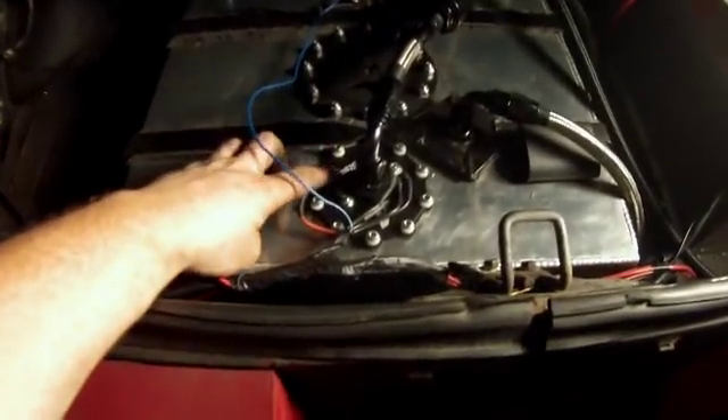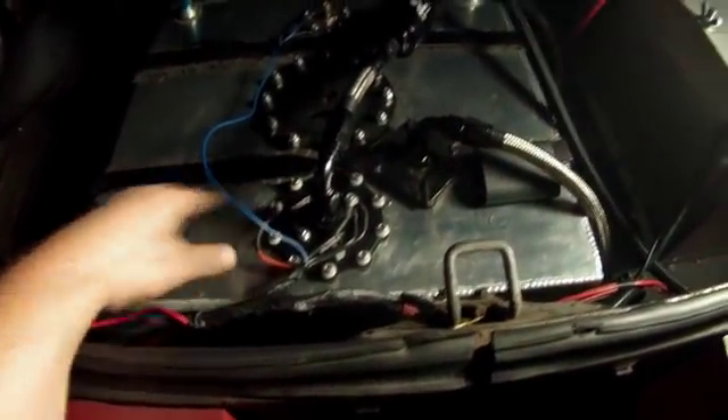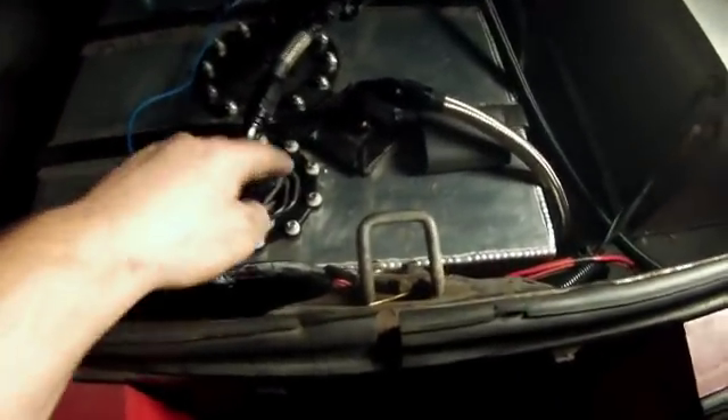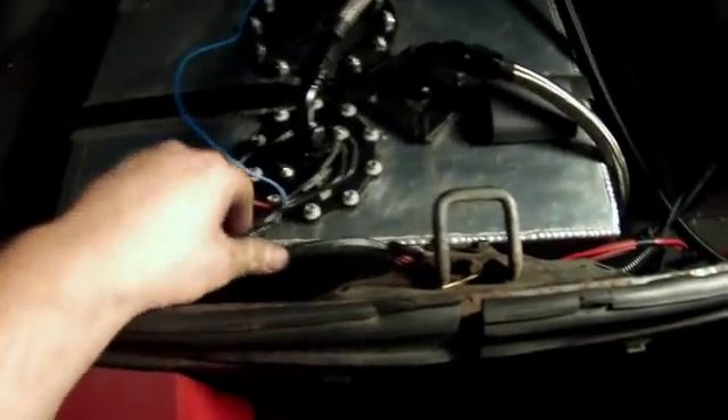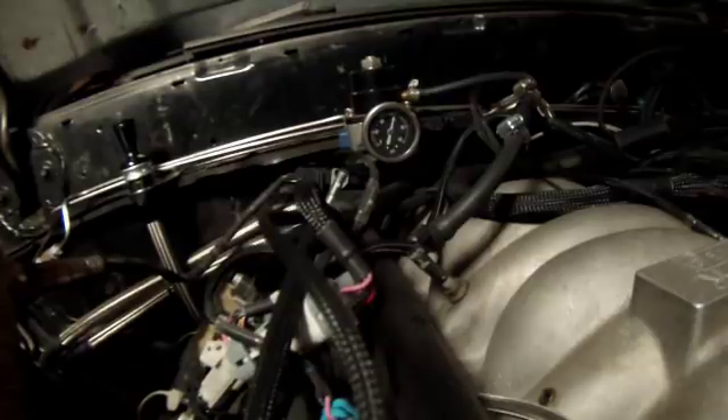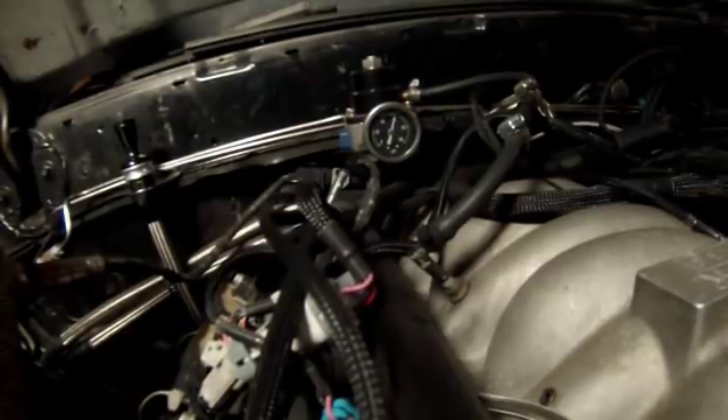Now that we've got the fuel pump in - you'll notice this is backwards - in order to fit both filters next to each other inside the boxed-off area in the tank, we had to turn it backwards because there was more room along the front. Just flip the positive and negative, which is no big deal - pulled a little extra wiring out and wired it up. The first thing I'm going to do is turn the car on and check fuel pressure, because now with two pumps it's going to create more pressure. If you have any questions drop a comment, hit the like button - hopefully we're going to get into the nines, so stay tuned and subscribe.